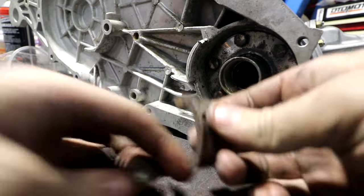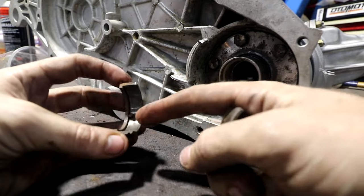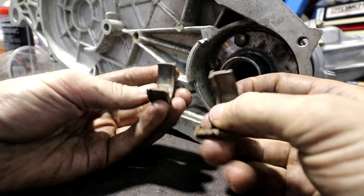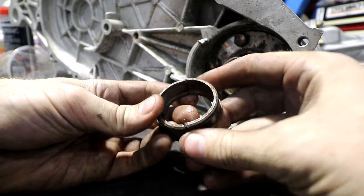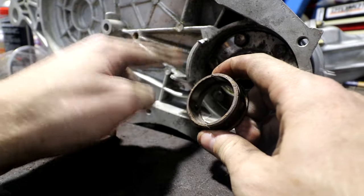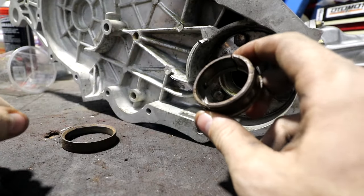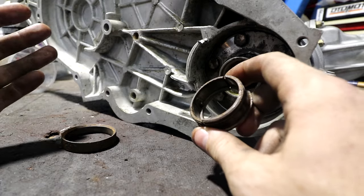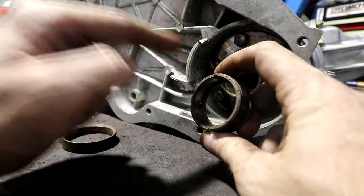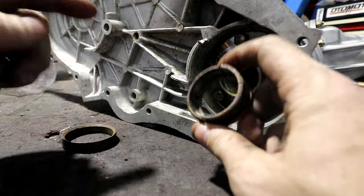Now, the way this setup works is there are these two pieces that have a flange around the inside and a little hole in them. So these go down over there, and that little inside flange locks into a groove there. So it acts like a C-clip, but we've got that thrust bearing in there taking all the cornering load this way, while cornering load pulling the wheel off this way is all taken by this thing. Obviously, if the wheel is pulling this way, it's the inside wheel, so it's unloaded, so there's much less force pulling the whole assembly towards us than pushing against that way,